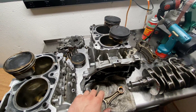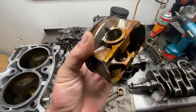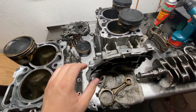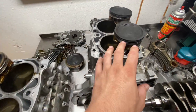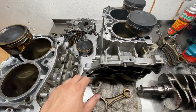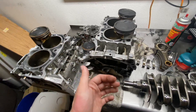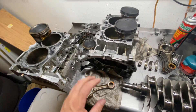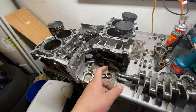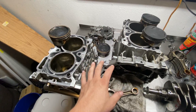Some people want numbers and they want it to be as hot as possible. The key is, if you're going to tune a car this hot and you want it to stay together, you've got to run a forged piston and just don't get stupid with it. Even with a forged piston you can still melt it, but the ring lands are extremely stronger compared to the stock piston, so you can definitely get more aggressive with your tune. At the end of the day, if you're not making enough power with the setup you have, you need to upgrade the turbo, get bigger injectors — you need to go bigger. When you put a stock turbo on a car with stock fuel injectors and you want to make 300 wheel horsepower all day long and do high-end 140 mile-an-hour pulls, this is what happens. Instead, change your intercooler, put some more fuel in it, step the turbo up. That way when you're making that 300 wheel horsepower, you have nice cool air, the components aren't being pushed to their limit, and this won't happen.